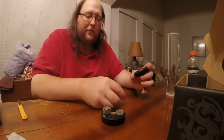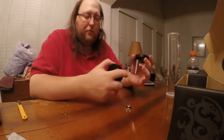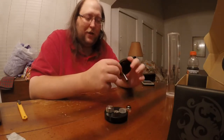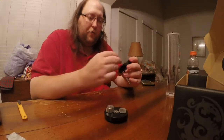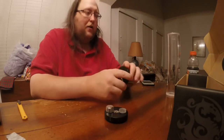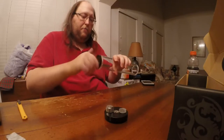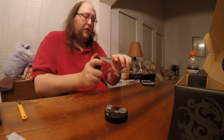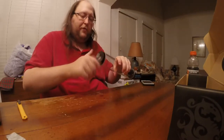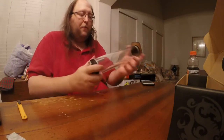They give you a lot of stuff to work with for different situations. I'm going to have a fill port hooked up with a 90-degree fitting that goes to a funnel, which has a G1/4 fitting on the end so you can hook it up to a fitting and have a watertight filling mechanism. Then have the tube from the MOSFET block come into another port. I took stuff off the bottom section and put them on the top three ports, then screwed everything the other way around. A lot of water cooling people use this reservoir - I think Singularity uses this size exclusively.